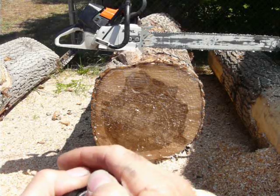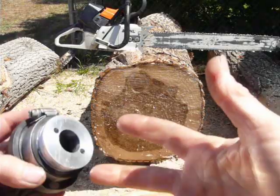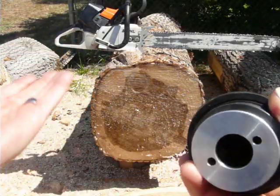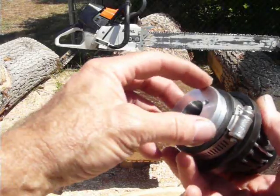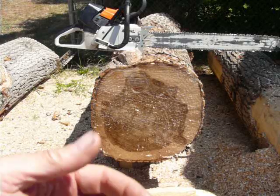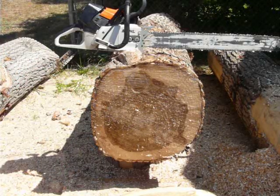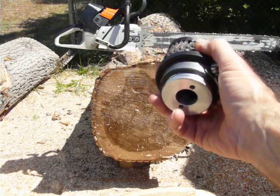Husqvarna's years and years ago, if you wanted to run an aftermarket kind of a system, you had to go with more of what we see here. People ran green weenies on the 660s, 046s, whatever. They were using a velocity stack as well. The problem with that is the carburetor's wide open, doesn't work in a rainy application. These things get thrashed in brush holes.